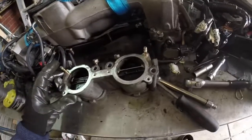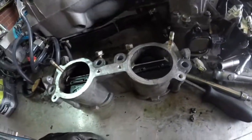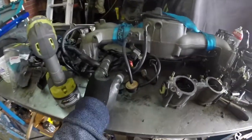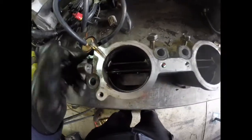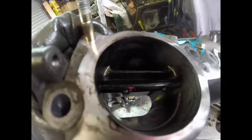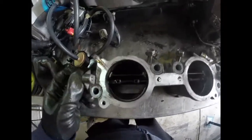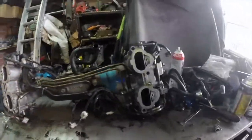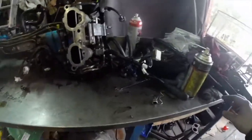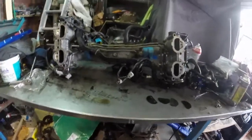Hey guys, we're on the right-hand side now. Nice to get all the screws out - I didn't have to drill this side at all, it's going to be a lot neater, which is good. I got the intake out as well - it's going to be running the GT35. Got the butterflies out. They actually all broke off, so I had to drill them out anyway - don't want a bit of screw to fall into the engine. Both TGVs have been de-butterflied, and here they are. Hopefully now we can flow more. I'm going to leave it there today, thanks for watching, stay tuned for tomorrow's episode. Bye.